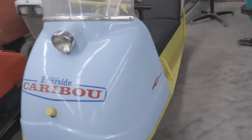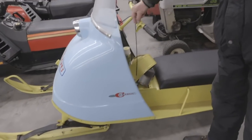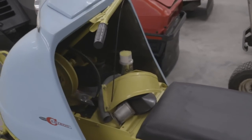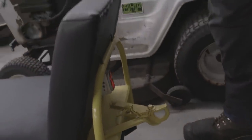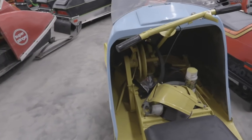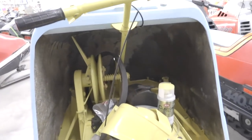Three-point motor mount. It had a handbrake operation to lock it in. Sachs German motor in it. A lot of grease fittings everywhere. And it even had a tow hitch in the back, a real solid one. And this had center drive to offset what Ski-Doo had on their two-drive, to keep away from the patent. They only made it for 1 year that I know of.